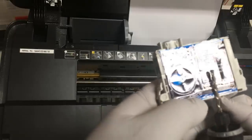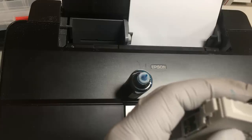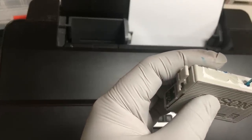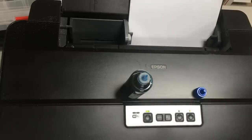This shows how deep we drilled and where we drilled. Now we will add five milliliters of ink into the cartridge. If the ink is overflowing, we should stop right away. We can seal the hole with a piece of clear tape.